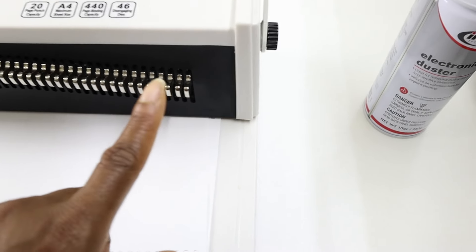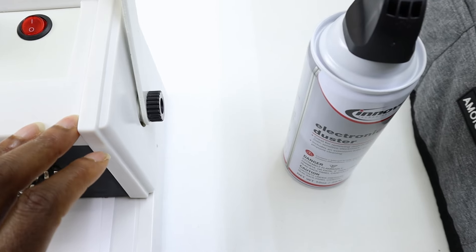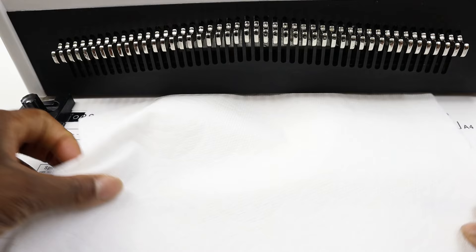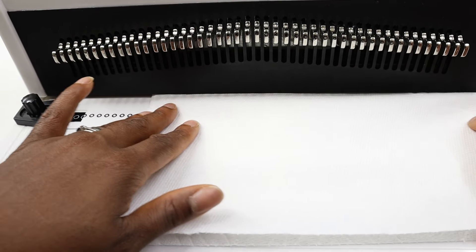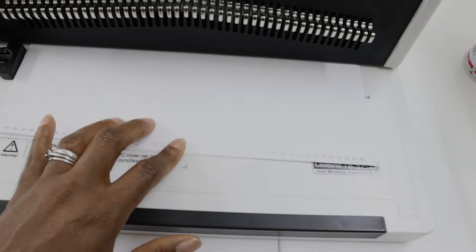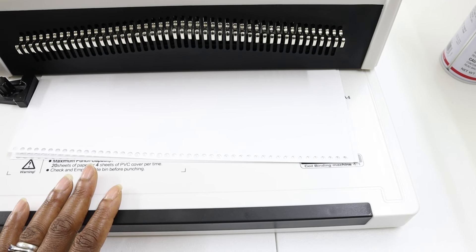One last thing I share in another video: if you notice your bar making a snapping sound, it could be that the knob and screws have come loose. One of them on my machine was coming out and I used a screwdriver to put it back in. Those can come loose over time, so you may just need to tighten the handle back into place. It might also help to take a folded paper towel and move it back and forth along the bottom area to pick up any excess oil and gunk. I didn't punch through it because I was afraid it might get stuck, but that could be helpful. The machine now moves smoothly — hopefully that was helpful, thanks for watching!